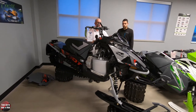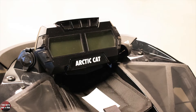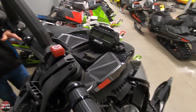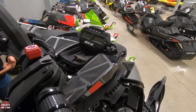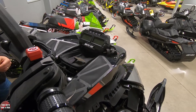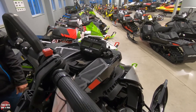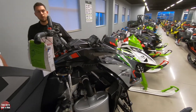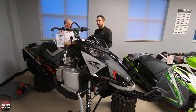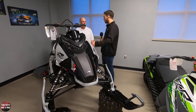The driver's information display: Arctic Cat does a dual screen. Without the machine running you can select what you want to see — typical things like trip one, trip two, total odometer, engine hours. Another thing you'll see on most sleds is elevation. Out west, RPM is more what you look at than speed. The higher you go in elevation, the more your RPMs are affected. Most guys out west will leave it showing elevation and what RPMs they're hitting to get peak performance out of their engine.